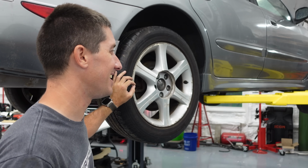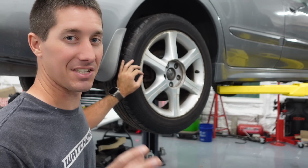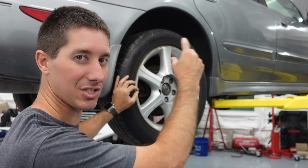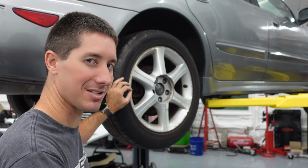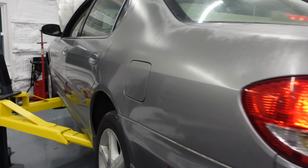That can cause contamination from the moisture to get transferred all the way back to the brakes and cause these calipers to seize up. So really, a brake fluid change could go a long way. I bet there's a ton of trash that comes out of these calipers and lines if we just pull the fluid out. So let's start with this brake light problem.